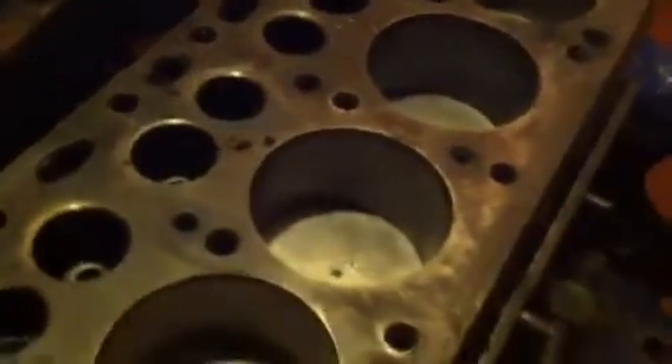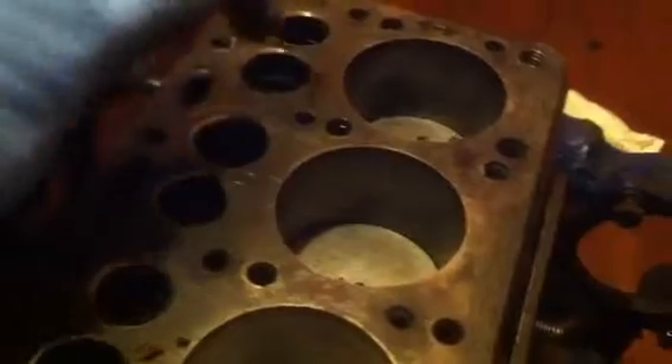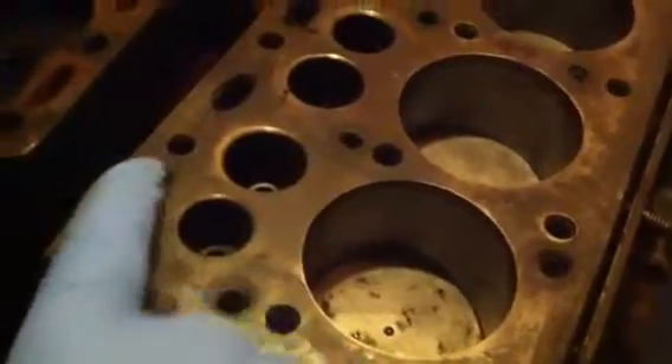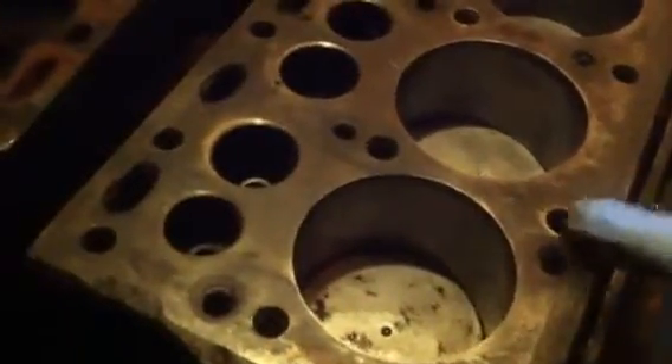In the first video, in terms of water jacket flow, there is flow along here. Water does flow along this side of the pistons. There's water flowing straight through here and then going in through here. No water flow, then there's water flow, no water flow, and there's water flow. Once it reaches the manifold side, water is pushed up into the head and flows around inside the head and exits through the thermostat housing.